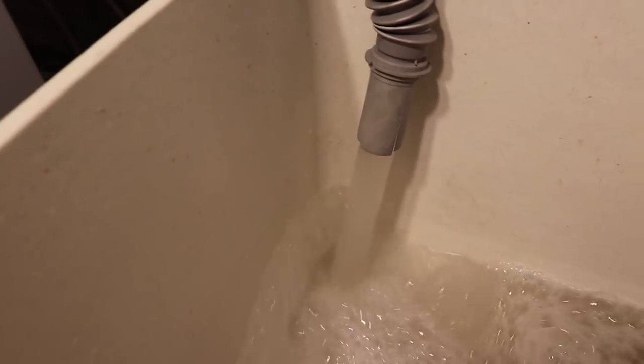And in the middle of the wash, it will just let the clothes sit in the water for about 2 minutes and then restart the whole thing again. And no water is being drained at that point. It just goes through the same cycle of agitating and spinning, then stopping, resensing, redistributing the clothes around the drum, reagitating and spinning, and so on and so forth.